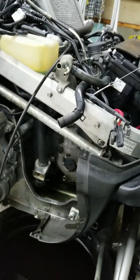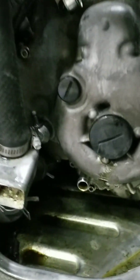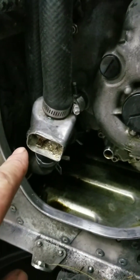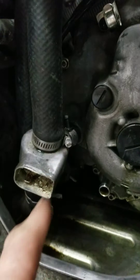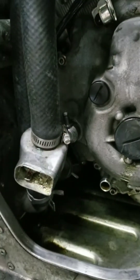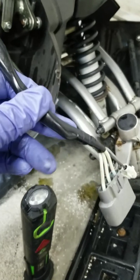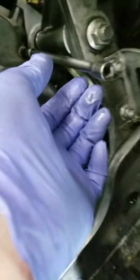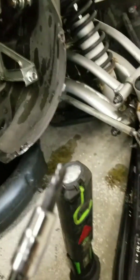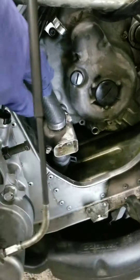Now I'm going to run the cable back through and pull it out. It should be as simple as undoing all the bolts holding that cover on and it should come right off. What I did in my case — this is my coolant heater, it was turned the wrong way — so to make room to get the cover out I loosened the clamps and rotated it 90 degrees so I can push it back. I'm taking off the bolts with a 5mm hex and an extension. I thought I might need a universal joint but I didn't — they're not overly tight and come out quite easily.